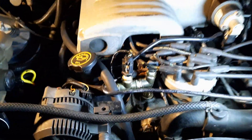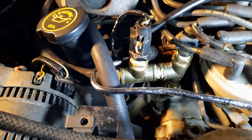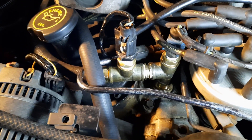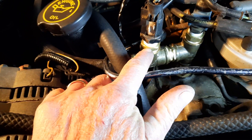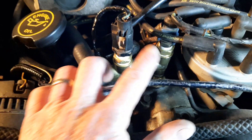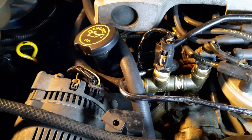G'day again. As you can see, I managed to reroute this heater tube — got rid of that metal tube that was going nasty and leaking. I've replaced it, as I mentioned in the last video, with tap fittings and brass pipe fittings. These ones here were the ones I was concerned about because they were a different thread, but I went to a place in Tassie — Rankin and Bond — who make things out of brass, and they had the fittings. The thread tape is what he suggested; he was a plumber and said just put thread tape around them all. I've had it running and they haven't come up to temperature yet, but so far so good.